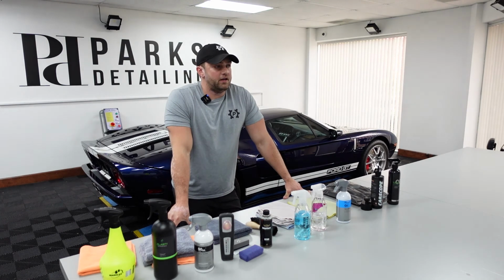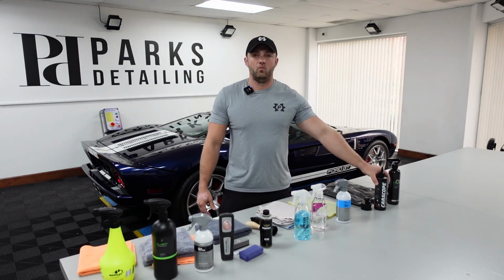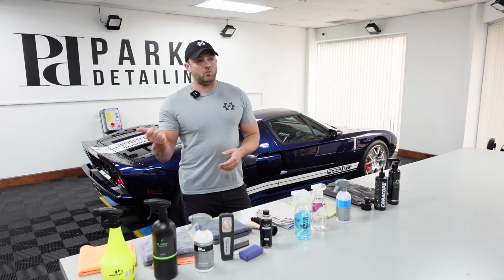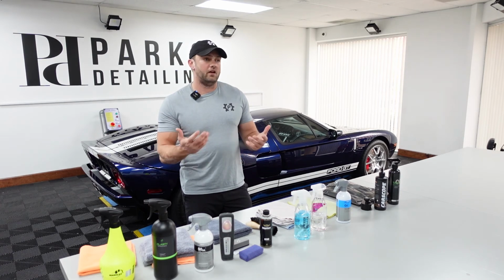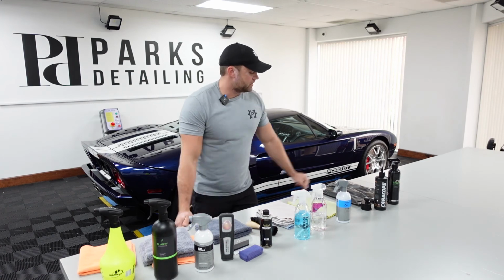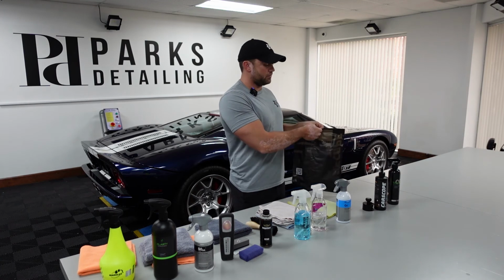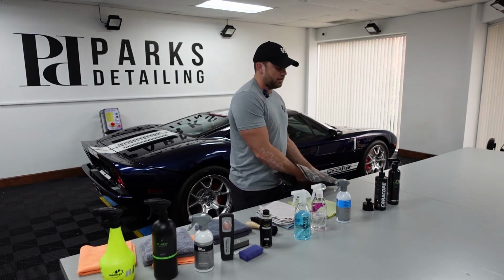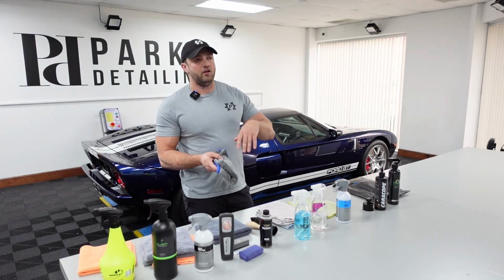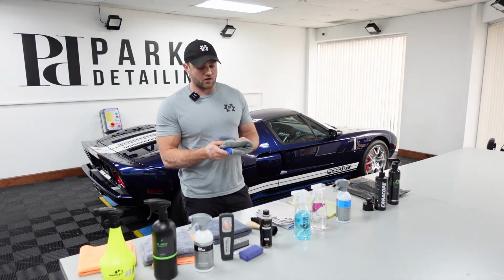The only exception I would say is, let's say I've already put on my ink one or two washes ago and I'm just putting another application on top of that, just wash the car. If you don't need to scrub the tires, you don't have to. They're not dirty enough. And then take something like a CarScope wheel and tire towel, dry the tire off, use a blow dryer, and put on your new application. So you're not having to strip it off with tar or Siege and tar every single time. You're just keeping the process going.